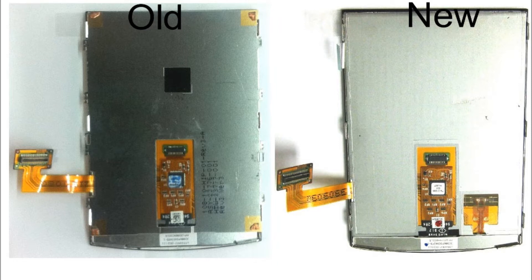These are examples of an old LCD similar to the original one that was in your phone, and a new LCD. The old LCD still has a back plate connected to it that has to be transferred to the new LCD. If the back plate is not transferred to the new LCD, it could crack or you could cause damage to the housing of the phone.